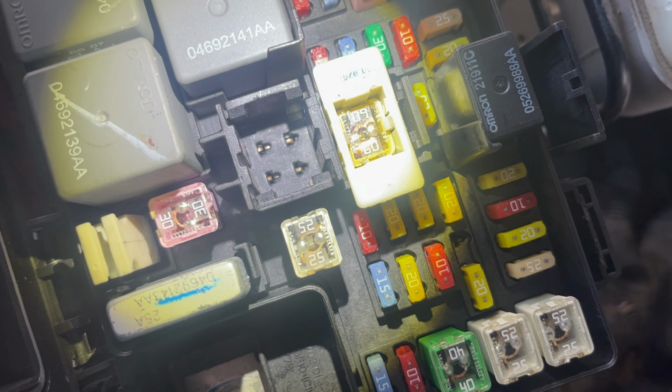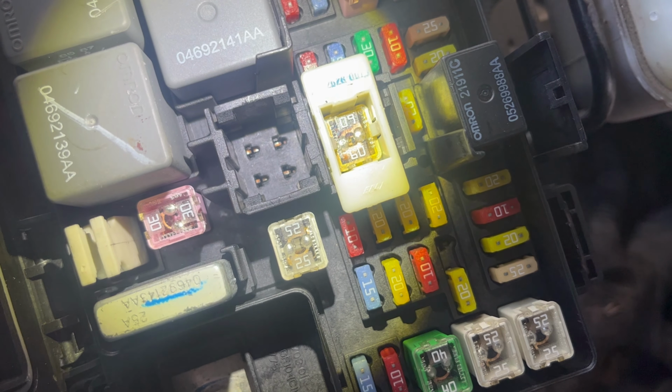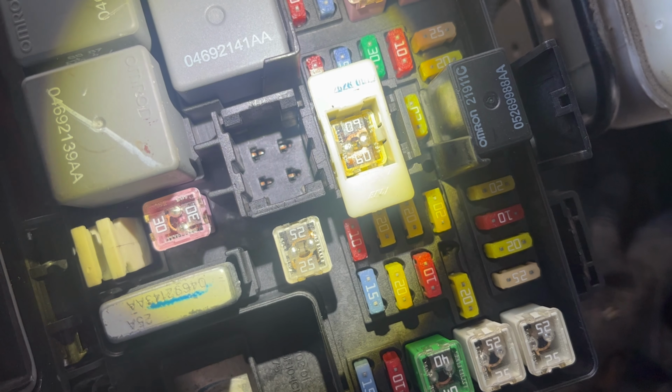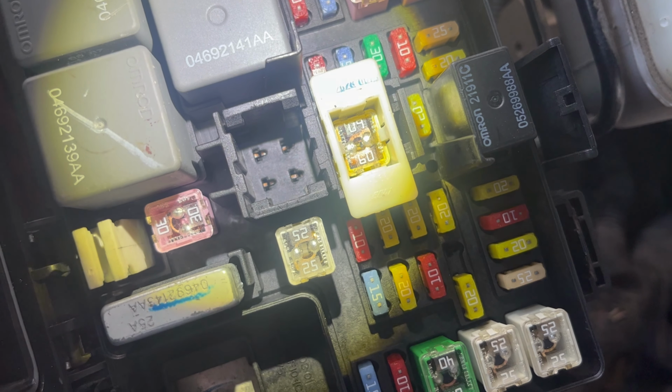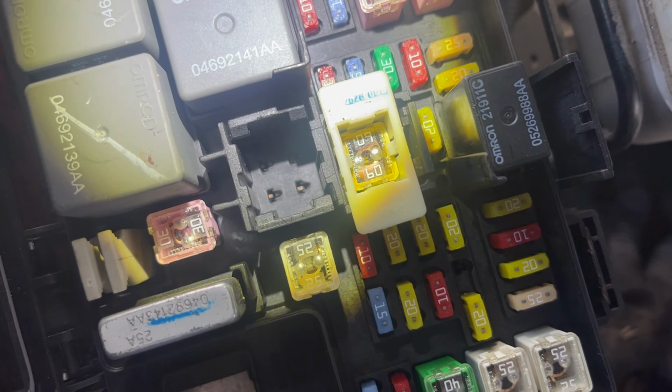So what I'm going to do is take that yellow fuse holder out of the picture. I'm going to take those 10 amp fuses out and just wiggle them in there. There's not enough play if you got that fuse holder on there, because it holds it pretty rigid. You can't wiggle it around, but I'll be able to get them in there like this.